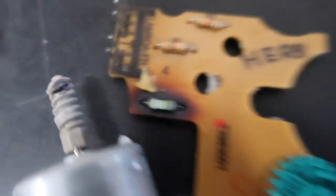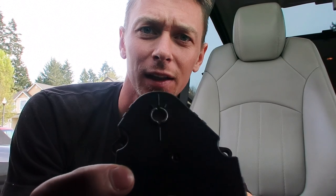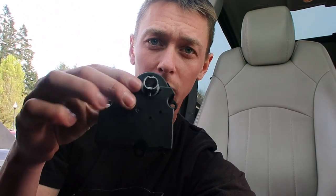That's shoddy work right there. So I'm getting ready to go ahead and put the new actuator in. Let's throw the old one away. And I was thinking about it — it's probably a pretty big deal on where the actuator is at position-wise. This one's stuck on the center. If you look on it, it's got a line on it and a cut in the little silver bit right here — that's centered. I can center the actuator up on the bolt holes. This won't turn without the motor turning, and the motor is a worm gear so it won't turn very easily. So I can just use that to rotate it. But where on the selector is that — is that the defroster? Is that feet only? Is that face and feet? There's five or six modes it could be.